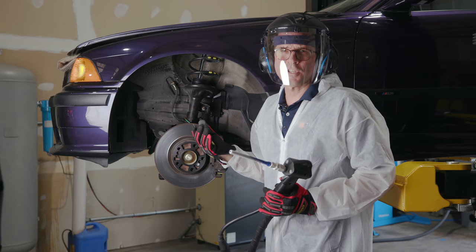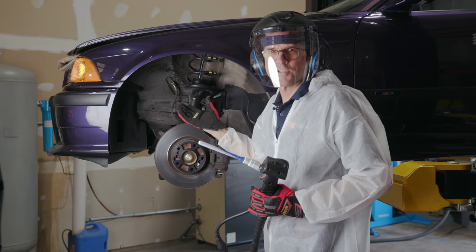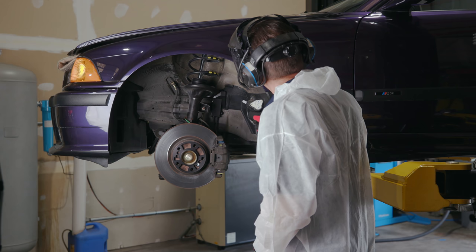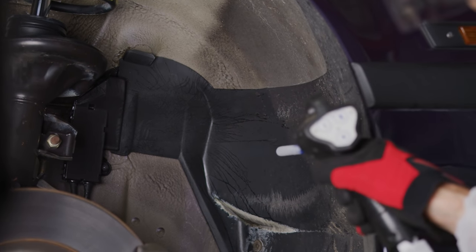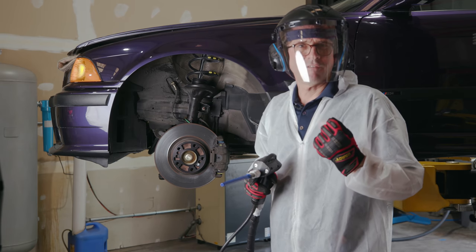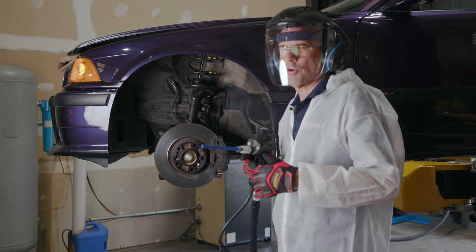Water. That's the condensation, it's drawing humidity out of the ambient air, because it's a humid day here today. So we're going to be fighting that throughout our process here. So let me just show you what happens when we want to clear that off. One of the things you can do to avoid that is to use less volume of dry ice, but the less volume makes your process slower, so you've got to be mindful of that. So you're always balancing this stuff.